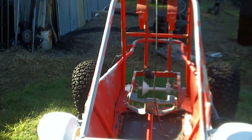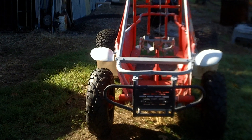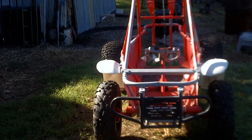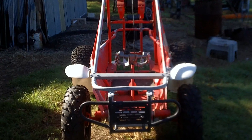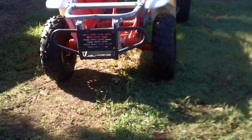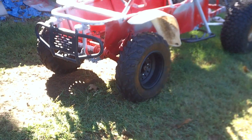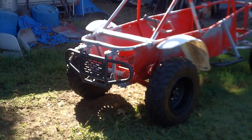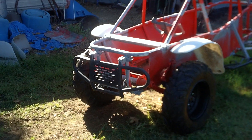From this angle you can see the rear is kind of wide. I'm going to try to order some rims with a one-inch negative offset compared to these, to suck it in a little bit more. That may be a problem as far as width — it's especially going to make it push on the front end, which is why I mounted the front rims outward. They're actually mounted outward but the tires are mounted right.